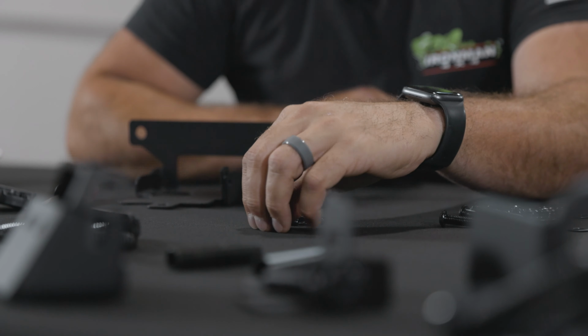Now we got to get our wire harness out of the factory front bumper. Be careful because these sensors down here are your SRS, and if you tear one of those wires up, you're going to be in big trouble. So I'm going to go through. I'm going to push all these little Christmas tree clips through. We'll get our parking sensors out. These are all 13s. All these guys are a T40.